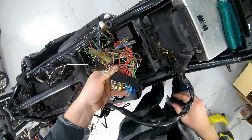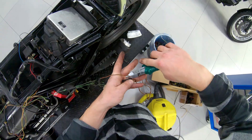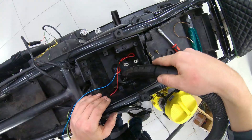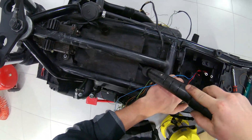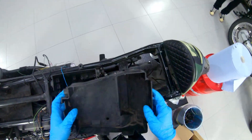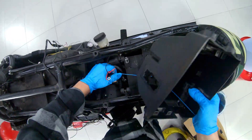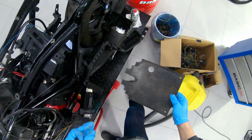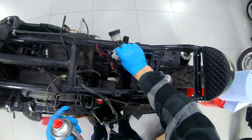The fuse box is also not needed. As a result, we cut off almost everything except the wires of the ignition unit, Motronic, and oil pressure sensor. We clean all the working surfaces and elements. The boxes and casing will remain in place, but it is more convenient to remove them for cleaning. I recommend thoroughly cleaning all the elements and wires.